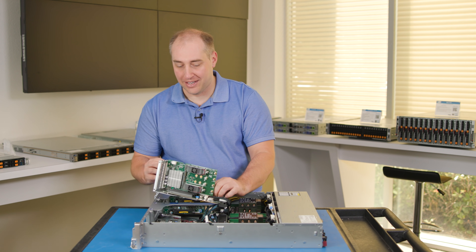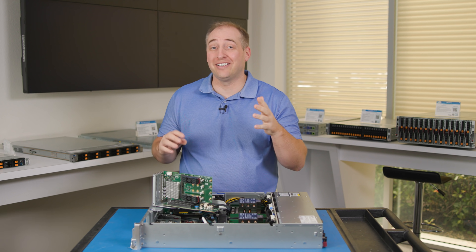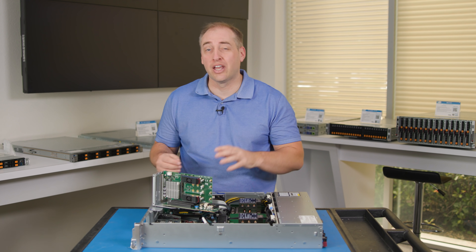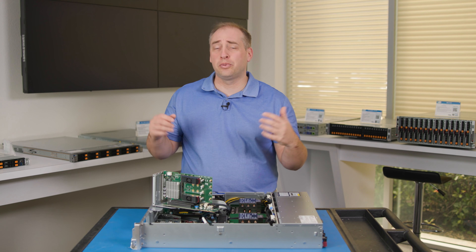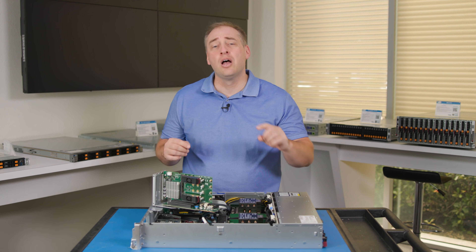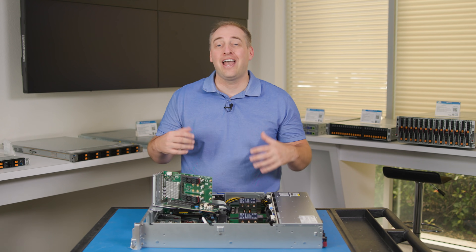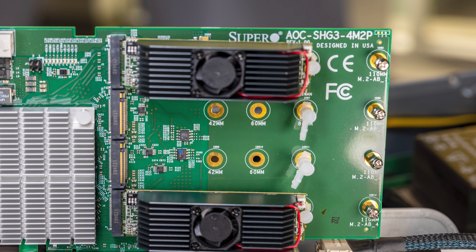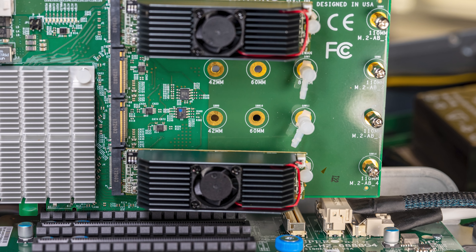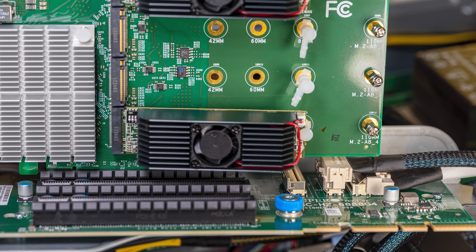For any storage buff out there — let's open up this riser. On this riser there are four PCIe slots. One of the things I saw in the system that is really cool and applicable to the edge scenario is this card right here. Supermicro actually has a card that can handle multiple M.2 drives. But in this particular use case, what you're going to see is these giant active heatsinks and fan units. The idea is that not only could you have SSDs, you could also put little accelerators — AI accelerators, little FPGAs, different accelerator boards built on the M.2 form factor — or you can mix and match storage and accelerators. This adds a ton of flexibility into an already very flexible edge system.